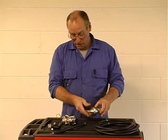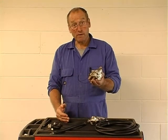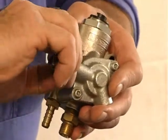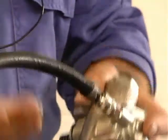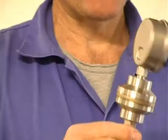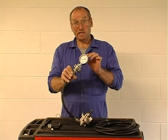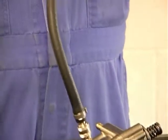For example, if we wanted to attach this gauge to a high pressure direct petrol injection system pump, once again having sourced the correct fitting, that can be applied to the pump, connected to the adapter, and the adapter to the gauge. So it's a professional, hands-free connection — perfectly safe — and in real time we can monitor the pressure in the system, which is also being monitored by a pressure sensor via the serial tool.